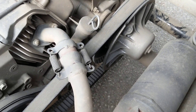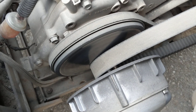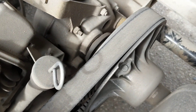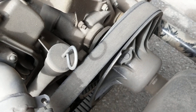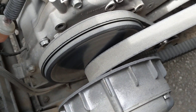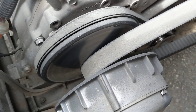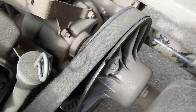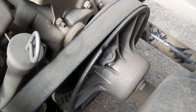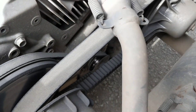If you compare this to a bicycle — gears on a bicycle — when it's stopped the clutch at the front is small. The travel around the diameter of the clutch is small and the rear is large. When you start this thing up and speed up the engine, this clutch actually squeezes together and enlarges the size of the ring that the belt has to ride around, just like shifting up onto a larger chainring on your bike, causing the belt to spin faster. And the rear drive clutch actually separates — it widens — causing the belt to drop down into the clutch, making the revolution path smaller, like dropping the chain on the back of your bike down to a smaller gear, causing the belt to rotate even faster.